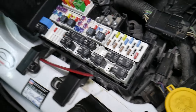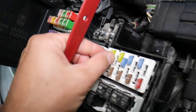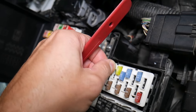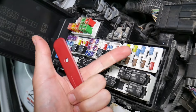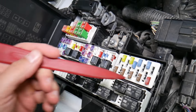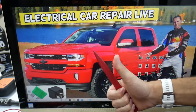Before we continue, let's explain quickly why it's always a good idea to test fuses and relays. It is very important — on those fuses you cannot clearly see if they're burnt or not, especially on JKs fuses. If you remove a fuse, look at it, and assume it's a good fuse, it could actually be a bad fuse. At that point you could reinstall the bad fuse and start replacing parts you don't need to, losing time and money. We'll put a link to a special video that will teach you how to test fuses and check relays easily in the description below.